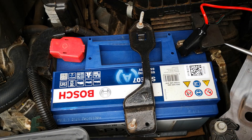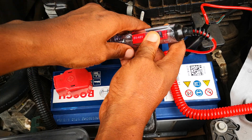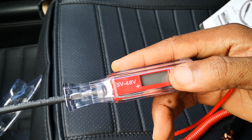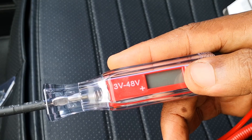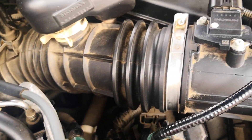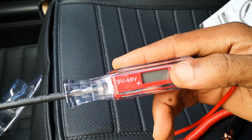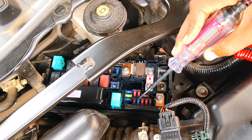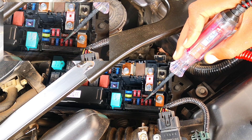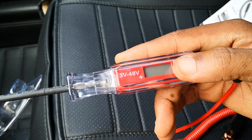On the car you just connect to the ground or to the negative terminal of the battery, and then use the pointed end to connect to the part that you want to read voltage from. The lower range of its voltage reading capability, which is 3 volts, is essential because that means you can use it to check things like reference voltage to a MAF sensor, which is typically around 5 volts. You can definitely use this to check continuity — just as I'm doing here, there's voltage on this side of the fuse as well as on this other side. So it's very crucial in terms of troubleshooting electrical issues.